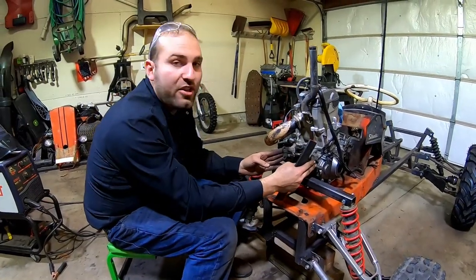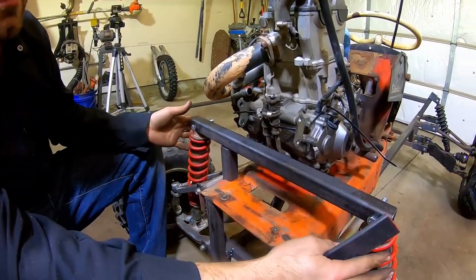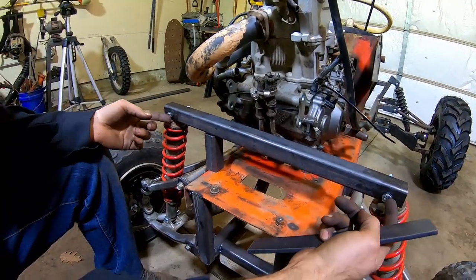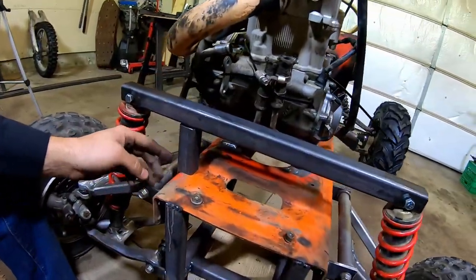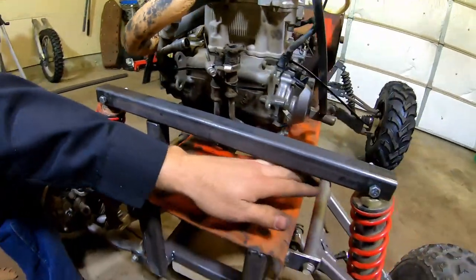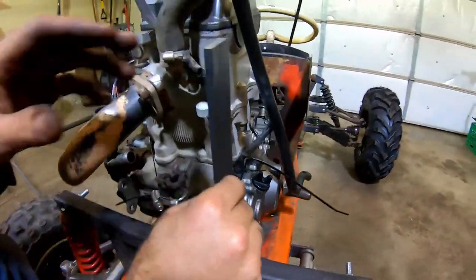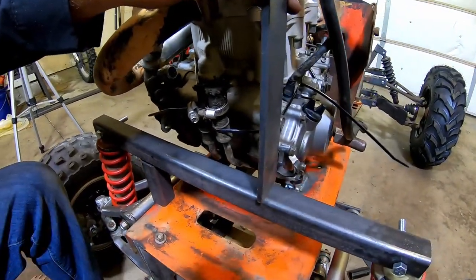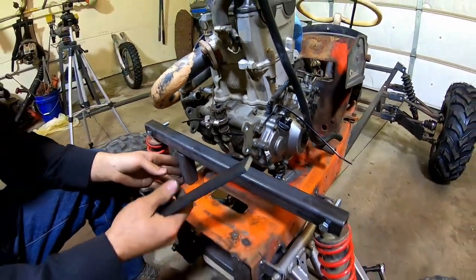When we were looking at the front engine mount, we decided to incorporate the front shock towers into it. We notched the tubes so the shocks go up in there, and we're building a couple little braces, kind of notching that out. We'll do the same thing on the other side — copy that — and when we do the engine mount, we'll cut some nice little brackets and weld them down in here so it'll all be one complete metal bracket.